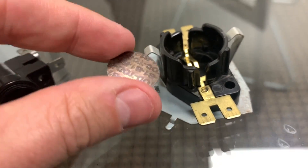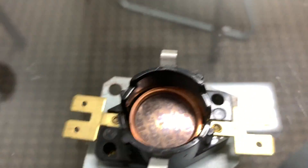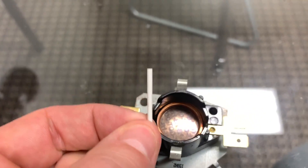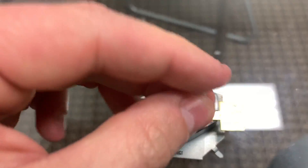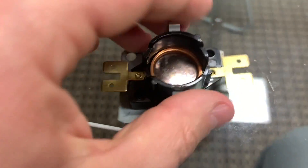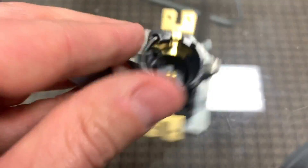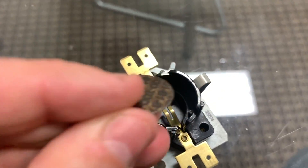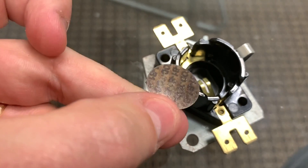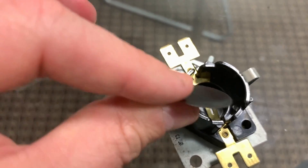This is actually the thermodisc, and it sits inside there. That's the disc that pushes on the rods that initially keeps them open. When it heats up, it snaps in — it deflects and bows inward — and that allows the contacts to close. It's heat, not magnetism. So it's resistive, not inductive. You can see the bow in that thing; that's what snaps in and out as it heats up and cools down.